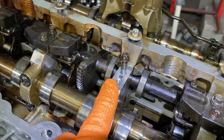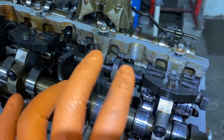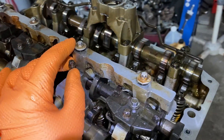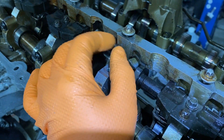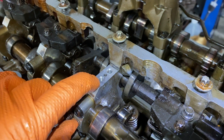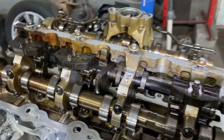You can do this for most parts on the engine. However, I would not recommend it for where the head meets the block — head gaskets require a lot of torque. But for something like this where you're torquing to about 70 inch-pounds, it'll be fine. The insert is steel, so these threads are actually stronger than the original aluminum threads.